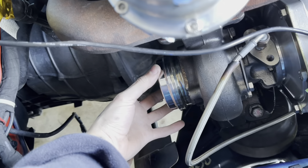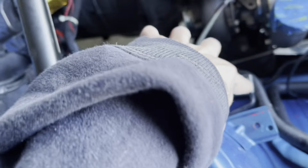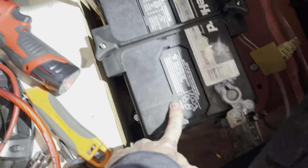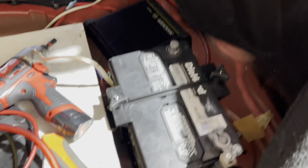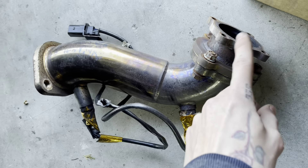This is going to be the last clip for the video. I did a lot of work off camera - let me show you guys what I did. First off, I got the correct V-band for the turbo - as you see, that clipped on very nicely. I also did the battery relocation. This right here goes through the cabin - I remounted the fuse box from here to here. This travels through the car, through the panels, all the way back. Over here I now have the battery with my ground down there. I relocated my amp right there. So I've got to go get the exhaust downpipe welded with this V-band now - I'm going to cut that flange off and weld the V-band on.